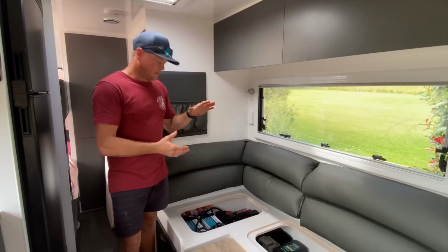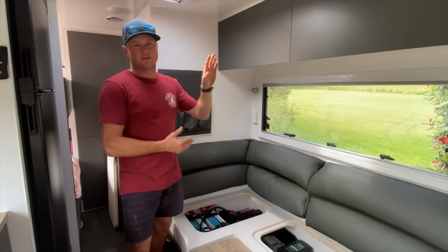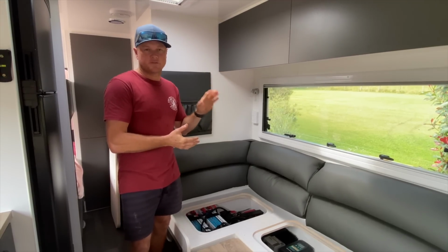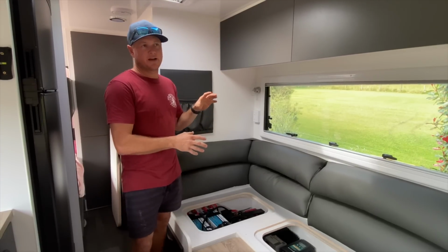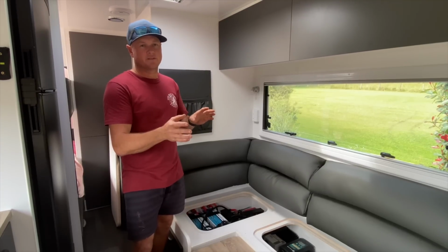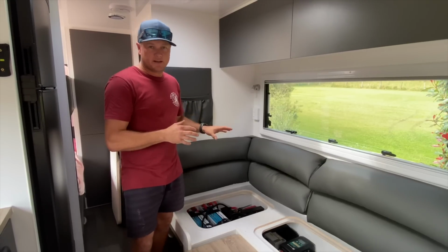The other thing being, if we had say 600 amps of lithium in there, we would struggle to ever get that fully charged off the solar alone. So if you're camped up for weeks on end, you will never get that charge fully back in those batteries, or at least I don't believe so. So I think a 400 amp setup with 850 watts on the roof and a separate regulator, so when you're driving you can get 40 amps off the car and up to 40 amps off the roof, is the perfect setup for that amount of batteries.